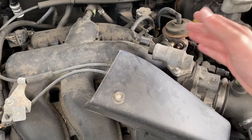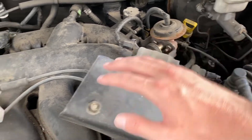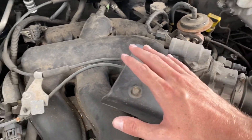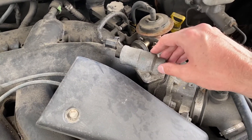When you're coming from a really high speed — say getting off the highway and coming to a stop at the exit — this valve will open and allow some additional air through. If it's not opening correctly, it will cause the engine to run lean and basically die out, not be able to have enough of the air-fuel mixture to run.